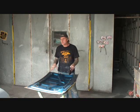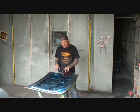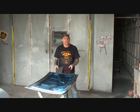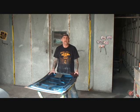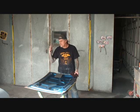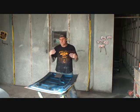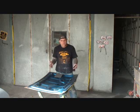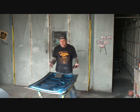What I'm doing right now is I am prepping up the inside of the trunk. This is the original factory paint on this trunk, and what we're going to do is go ahead and use scotch brights to prep that up. Since this is on the inside of the car it's never going to see daylight, so we won't have to sand it down like we did the outside of the car. But we want to prep it properly so our paint and our epoxy primer will stick and we won't have any problems.